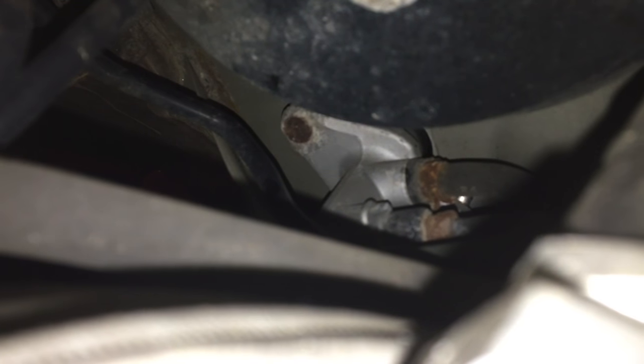So you've got the hose here — you can see it down there. I'm going to take the tire off just so it's out of my way, and then I'm going to go up here where the clutch line is, somewhere in this general area. Taking the tire off makes this a lot easier. Now the next step to get that master cylinder out of there — I took the tire off and came under here, then just pulled that master cylinder right out.